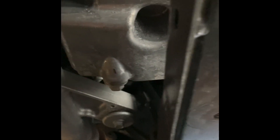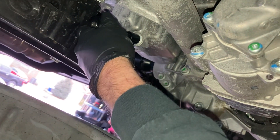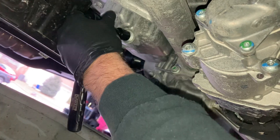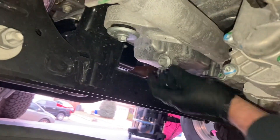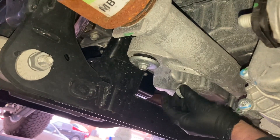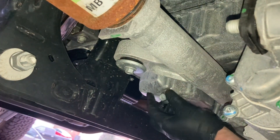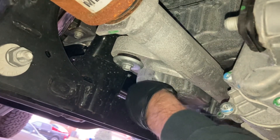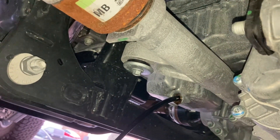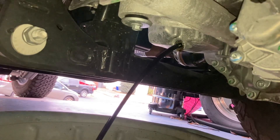Be careful — if you've been driving a lot, that drain plug will squirt out. Right now I'm underneath the passenger side of the Bronco. These drain plugs are usually pretty tight the first time. Have your pan ready because this thing will shoot out, and don't drop your drain plug. Get it off, and keep your hand away from the hot oil because it'll burn you — and there she goes.